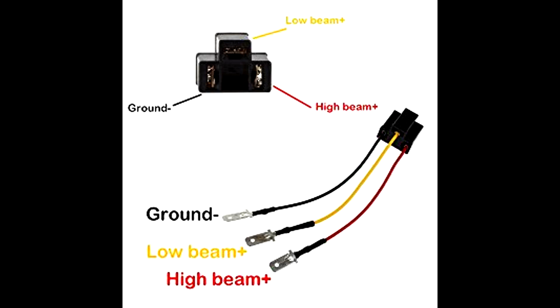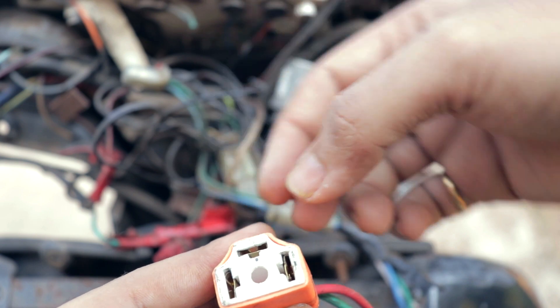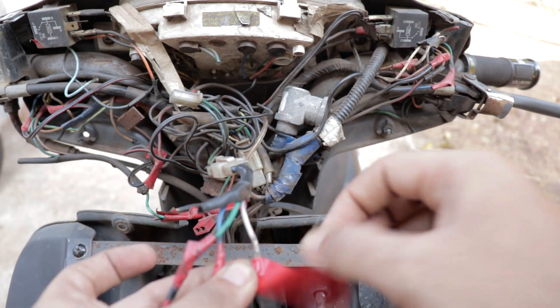The configuration of the H4 pin is as follows: ground, low beam, high beam. In case your wire color is different, connect one of the two remaining wires to check if it is high or low. Alternatively, you can also use a multimeter to find out the high beam and the low beam, which I prefer all the time. Once everything is sorted, connect the holder to the wires accordingly and secure it with insulation tape. Make sure you insulate every joint properly — you don't want something burning up inside your bike.